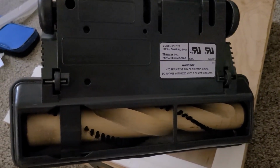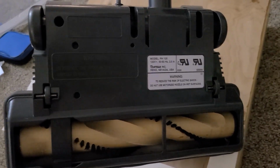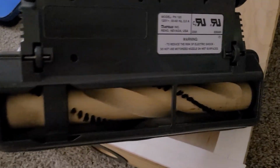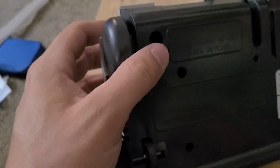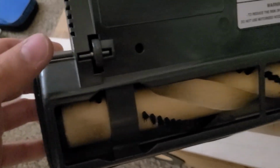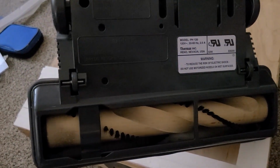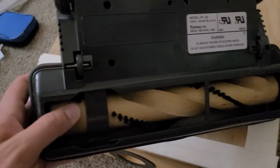So, I just took the nozzle tests on here, and I thought we should just have a quick look at this and end a discussion about it. Part of the reason we're getting such poor suction numbers out of this thing is it's held together by some clips at the front and 2 clips at the back. There is 1 screw here, and there's really no sealing between any parts of the housing. It's quite similar to a Hoover Powermatic or Spectrum or something like that.